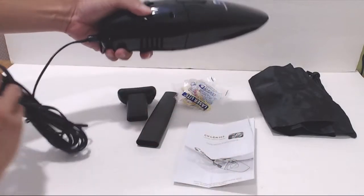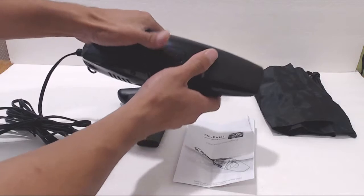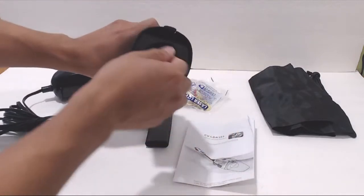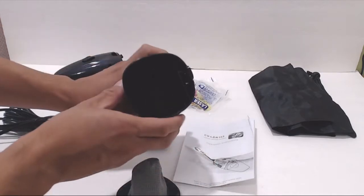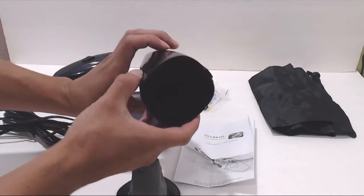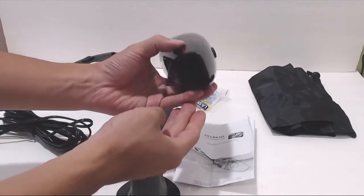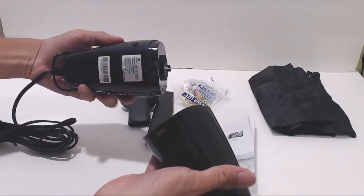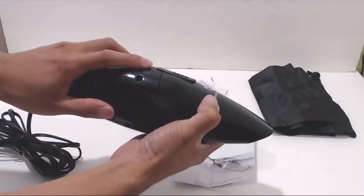The unit does not have a battery. This vacuum has a small dustbin on the front that detaches by pressing this button. Inside, the fabric dust filter is removable with a firm pull, and it's washable in water. The dustbin can hold about a cup of debris, and it's also washable in water. There's a rubber flap inside covering the inlet hole that prevents dust from leaking back out the front. To reattach the dustbin, hook it into the latch on the bottom of the motor unit and close it until it clicks.